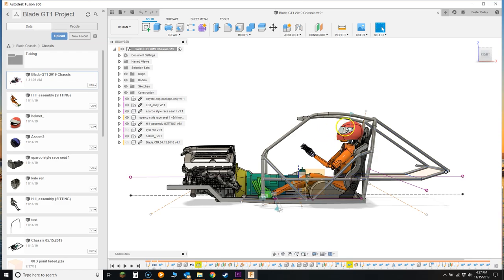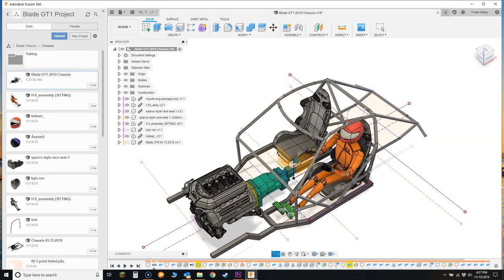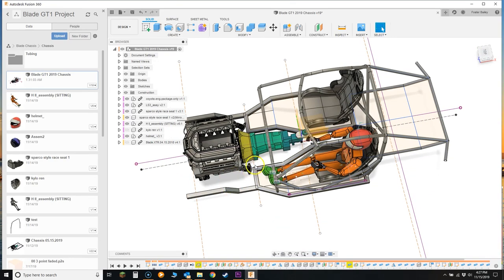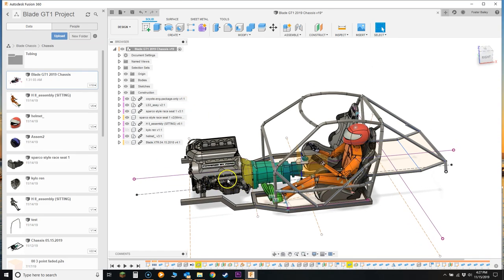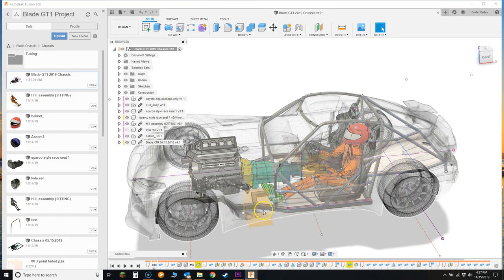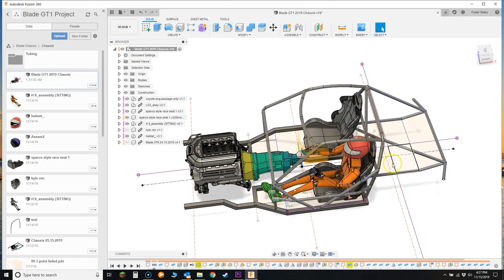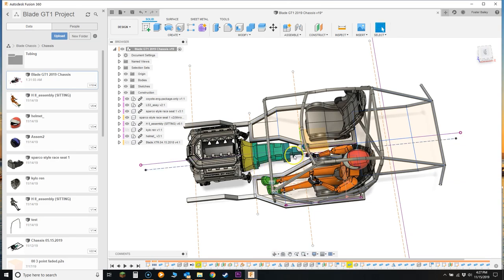The seating area will probably be about five to six inches forward from where the mannequin is right now, so we'll place the driver a little more forward. I just needed to see where the space was relative to the curvature of the roof structure. One challenge will be running the exhaust through to the back — the headers will face forward where the turbos are, routed back out, and exit through the side of the car in the front. I'd also like an option for the exhaust to exit out the back, which will be challenging.